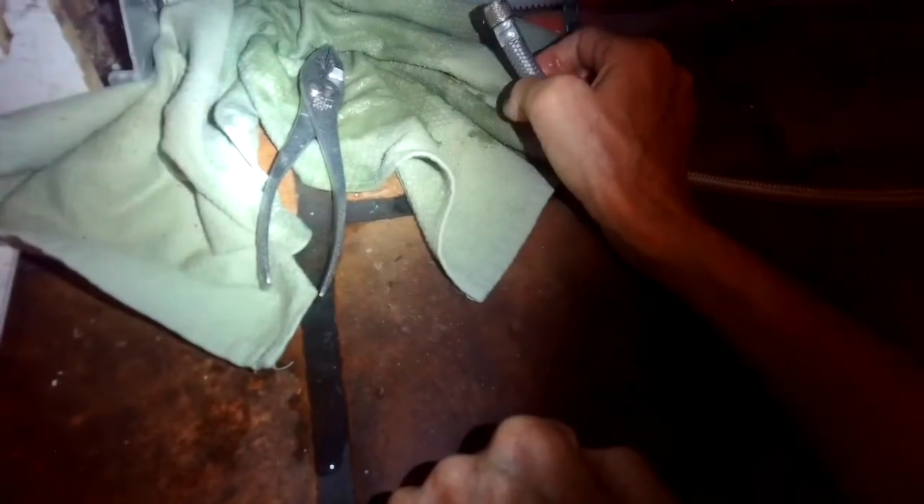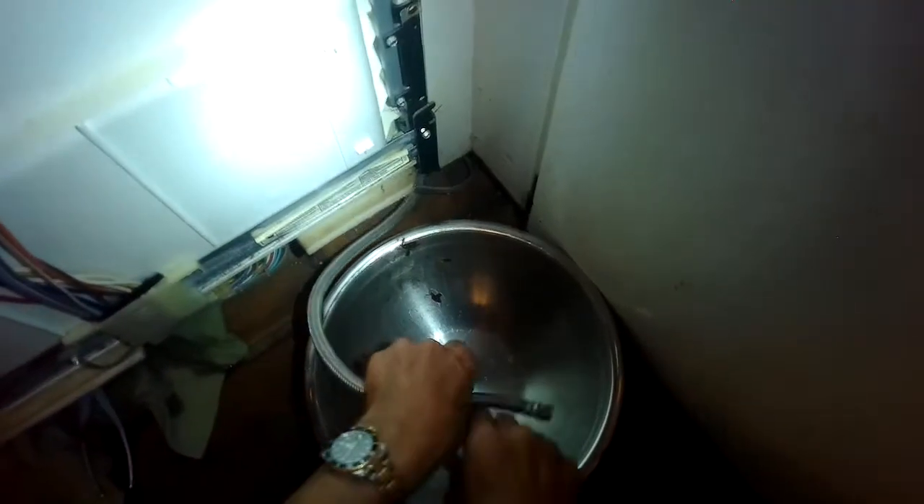I'll lift up on the front panel and that's going to slide it off of two little lugs that are holding it, and get that out of the way. Now I've got the water turned off, got it unplugged. I use my pliers to spin off the water line, and the water didn't fully turn off, so I'm going to let that water line sit in a bowl so it won't leak everywhere — sometimes the valves on the wall don't fully turn off.